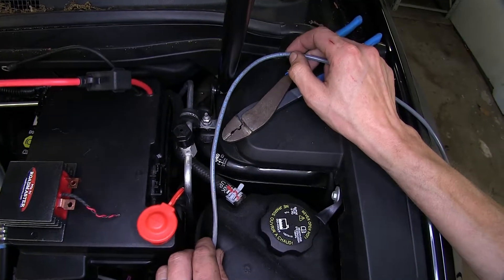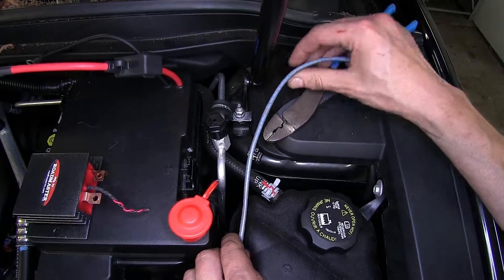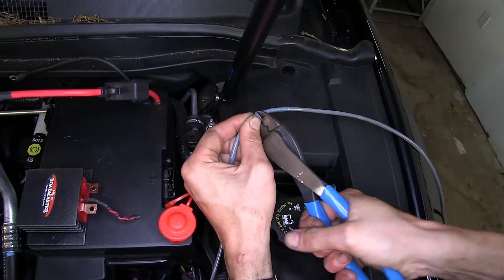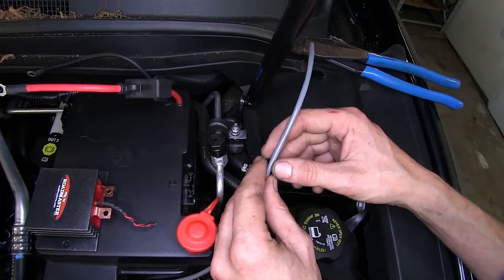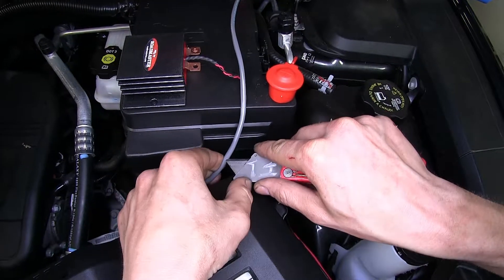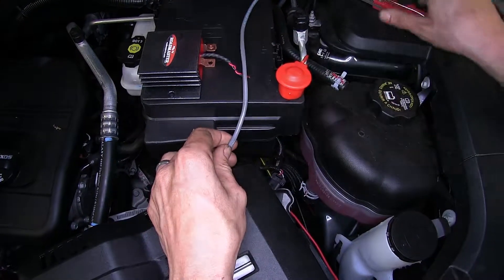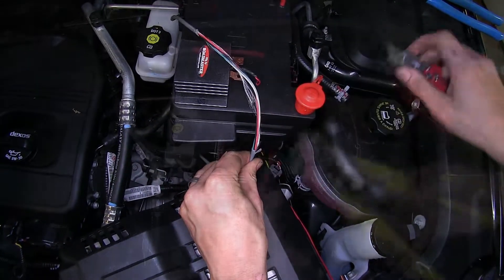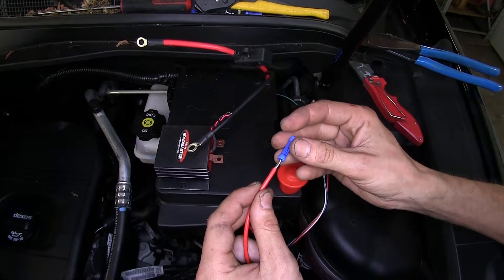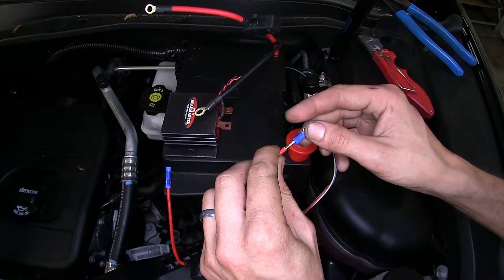One of the wires inside our harness needs to be grounded — that's the furthest point away from our wiring harness. We're going to measure off to this ground point, giving ourselves a little extra slack, and cut off our excess wiring. Now we'll strip back the outer sleeve using a utility knife, making sure we only cut through the outer insulation. We'll take our small fuse holder, strip back insulation from both ends, and crimp on one of our blue butt connectors on one end and one of our ring terminals on the other end.